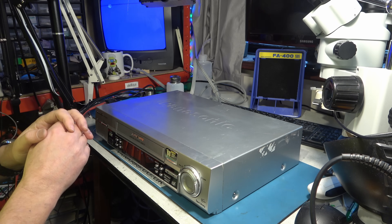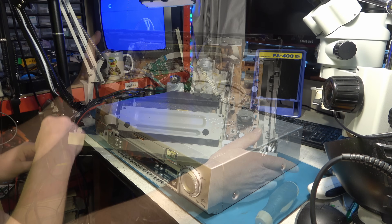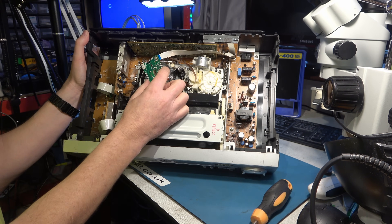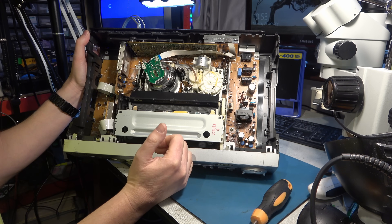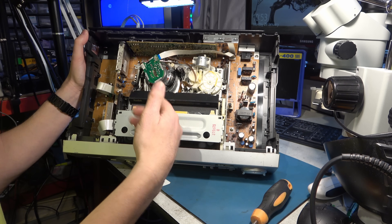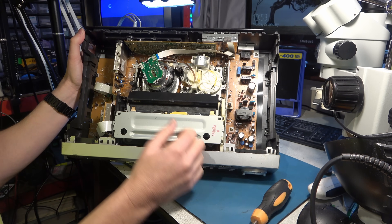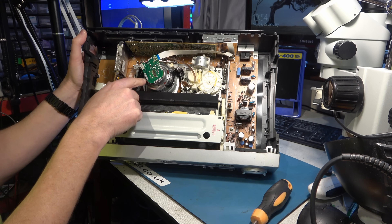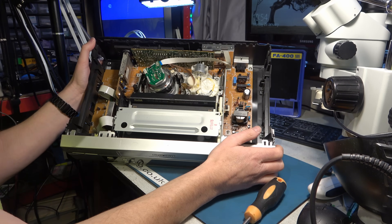I need to take the head motor apart again — it's fairly easy, let's get stuck into that. I had previously made a workaround adjustment to the position of this motor, which is supposed to be normally vertical. I'd rotated it about 45 degrees to get the head switching point roughly right, then let the machine do its own fine adjustment. But clearly the motor is all wrong because the magnet beneath it has shifted. Let's take this apart, get to that magnet, and correct its position.